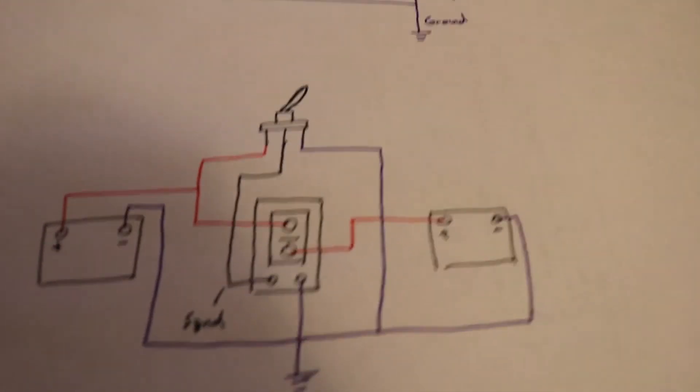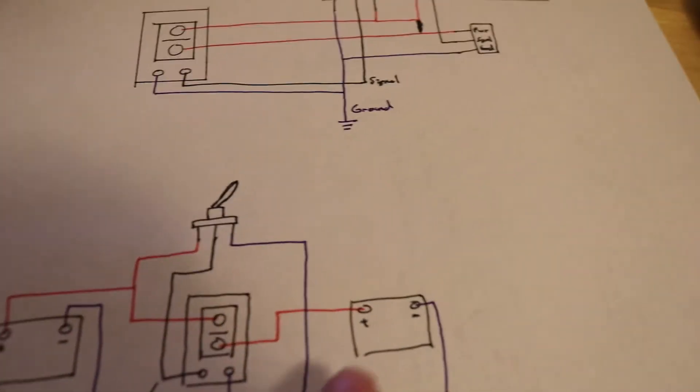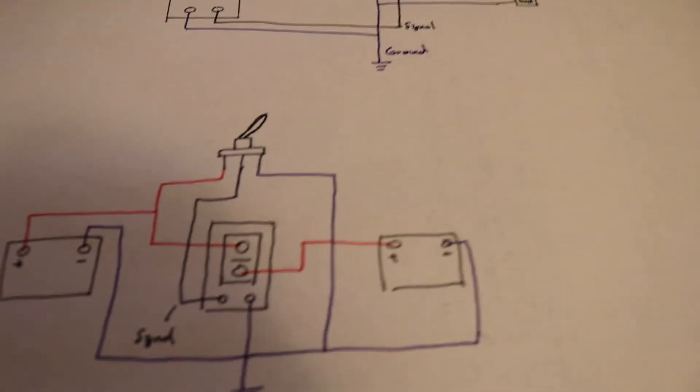When it's off, the two batteries act as separate systems. When it's on, they act as one system and you can charge both. For example: you can have the secondary battery running your system while the main battery is off. When the secondary dies, start the car and it begins charging. Then flip the switch and it'll start charging the secondary battery as well — and that's basically how it's normally run. I hope you enjoyed the video; if you did, please give it a big thumbs up, subscribe if you haven't already, and I'll see you guys on the next one.